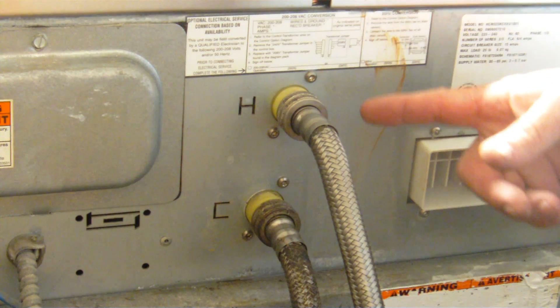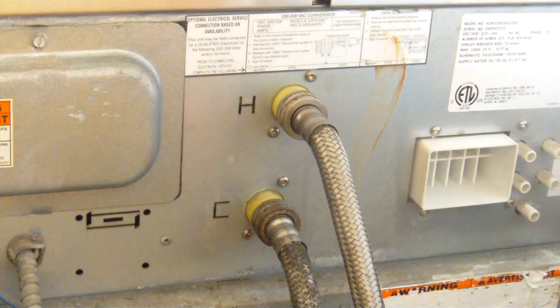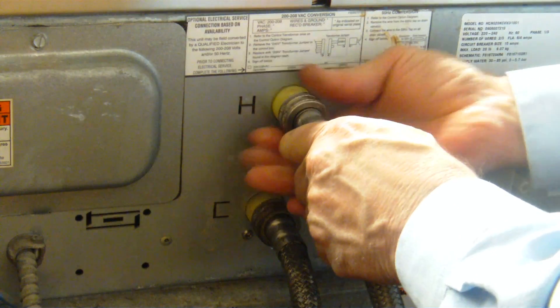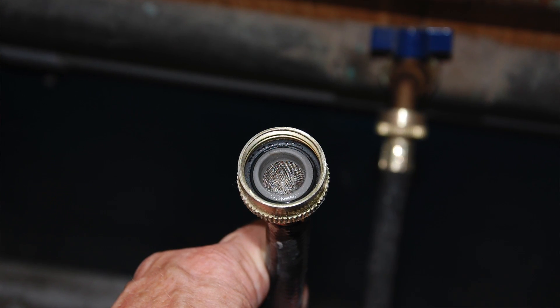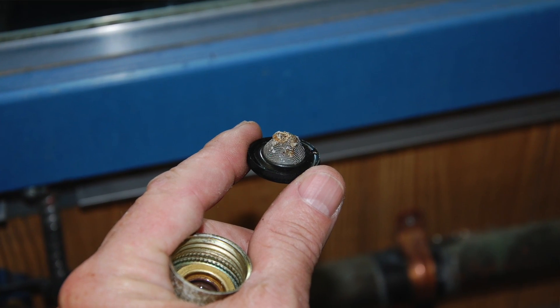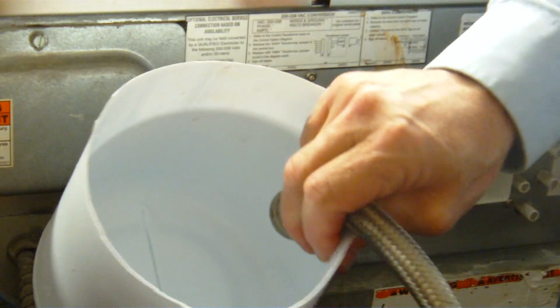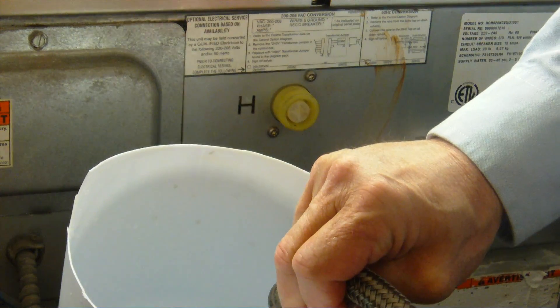The other problem could be with a clogged water inlet valve screen. We've turned off the water. We basically have an inlet valve screen here — it doesn't look too bad. But what we're going to do is take the hose and flush it. What you're going to see is that in the bucket itself there's a bunch of sediment. Even though the inlet valve hose screen was clear, the pebbles actually fall down into the hose itself, so you have to flush it to make sure that you get everything out.